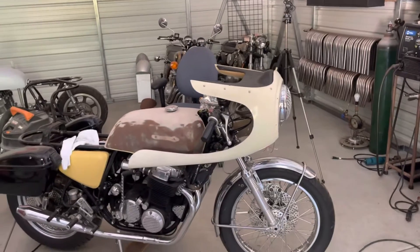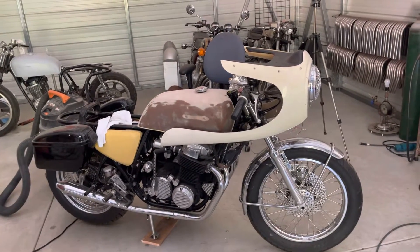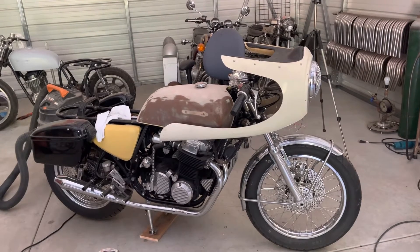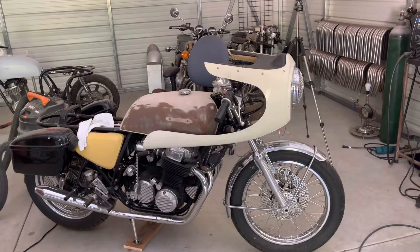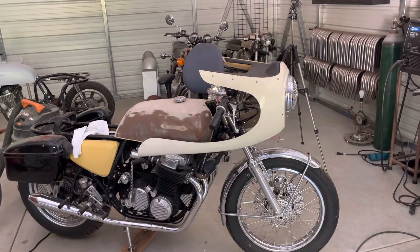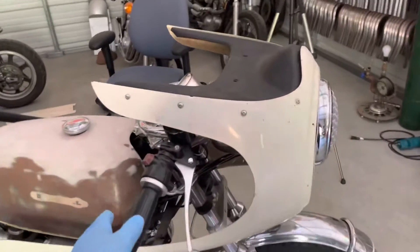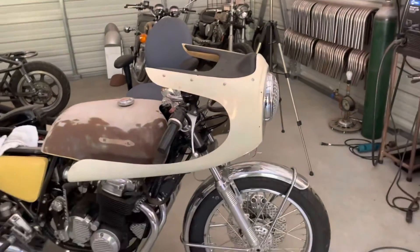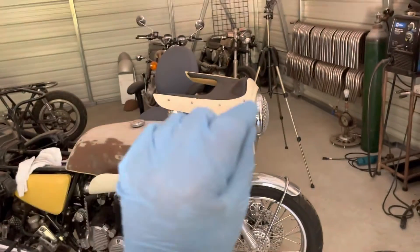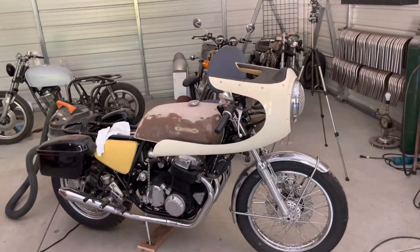When you're building bikes, if it's a universal fit it's not going to be a straight fit. So you make do with what you've got. It's mainly cutting and heating and re-welding, and making sure when people put fairings on that you're going to get enough swing on the handlebars. I'm going to have to put a shorter master cylinder on because it's catching, so I'll put a race one on — that will solve that issue.